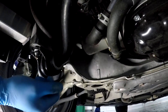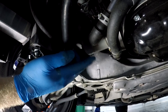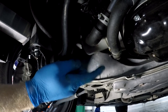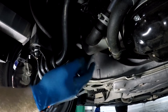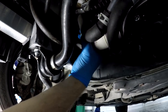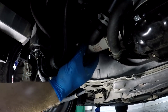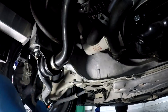Now this next part can be a little tricky to do if you're just doing it with your hands, but we need to get the oil filter removed. I usually just hand tighten these, but the technicians at Nissan probably used a tool and it's going to be pretty difficult to get off most likely. I'm going to see if I can remove this with my hands — if not, we'll need to get the tool to remove the oil filter. You're going to need to get a firm grip around it and twist counterclockwise. And even though most of the oil is drained out now, this is still going to pour a little bit, so make sure you get your pan underneath it.